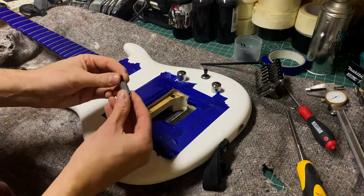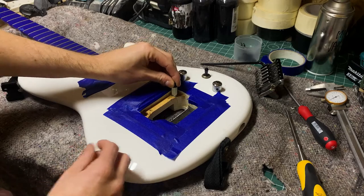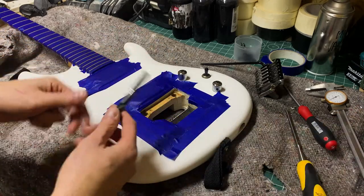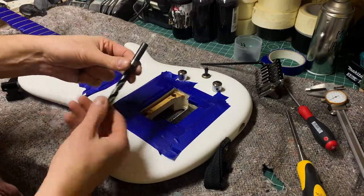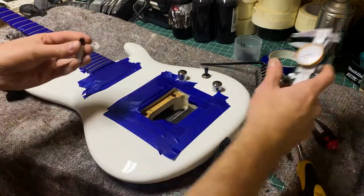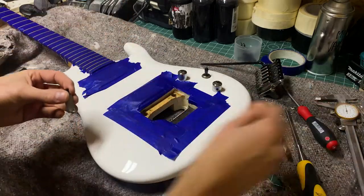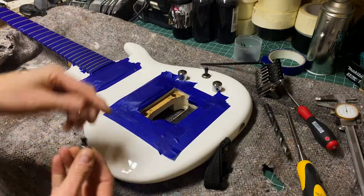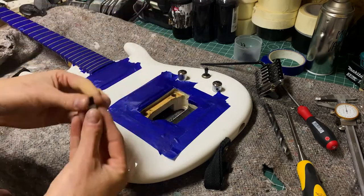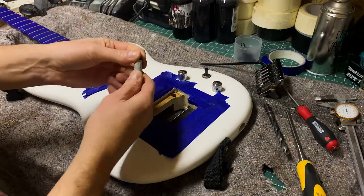The first thing is these new studs are slightly wider than the original holes so we've got to drill that out. I've got a 10mm which fits snugly — I don't have a 10.1mm which is the actual measurement for this one. So I think what we're going to have to do is just fudge it a little bit and wiggle the drill about. We want a snug fit anyway so we'll end up tapping this in. Let's go on with it.